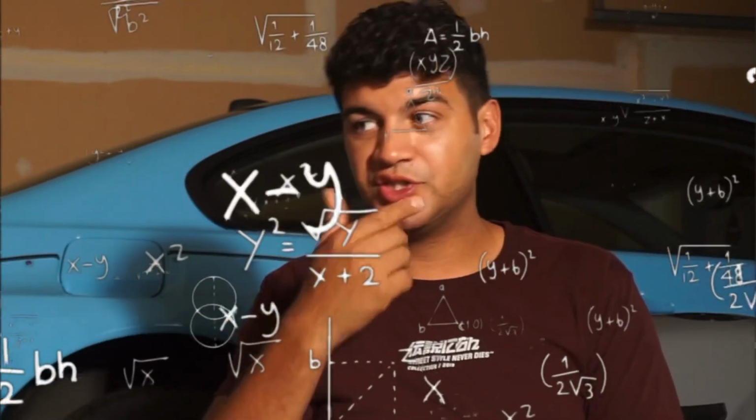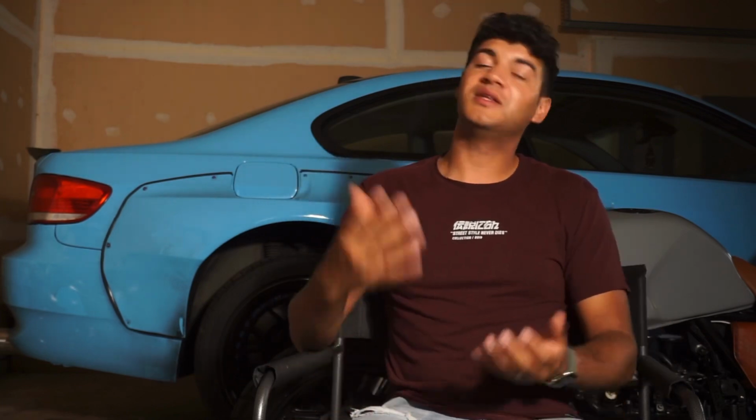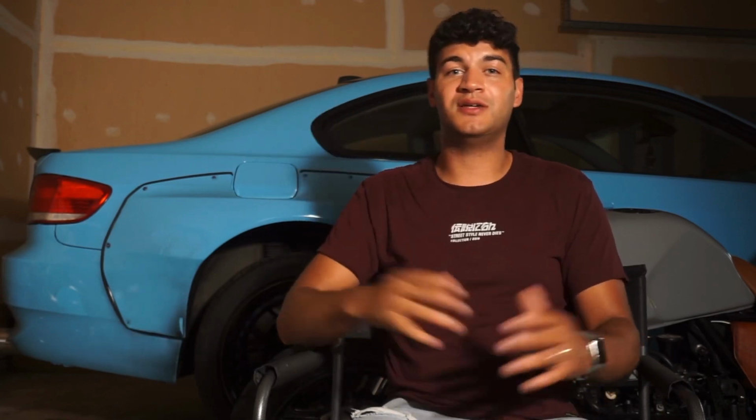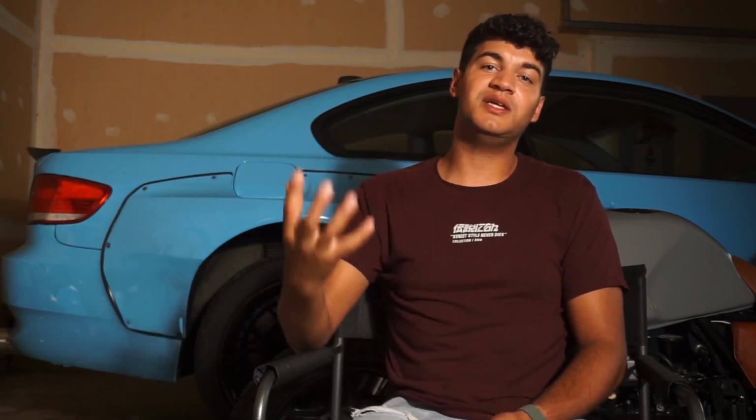But you know something that is cheaper, I guess. Hey guys, if you want to save some money, you can throw some E85 in the car. The stock fueling system can handle around an E40 to E50 mix. E50 is pushing it a little bit much, but you'll just have to switch your map to an E50 blend or E40 blend. I'm not too sure what they got on there for JB4, but that'll save you a little bit more money. So technically, this mod helps you. It actually does help your motor. It helps cool it down and reduce timing and everything. So it's kind of a benefit to be using some type of E85 blend.